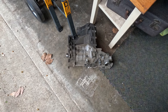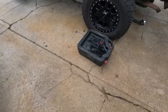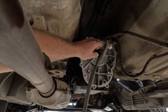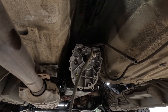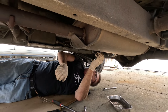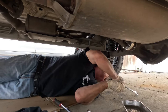As you can see, I got the old one out. It's a little dirtier but looks good on the outside — the inside's a bum. I took the drain plug off and found a couple pieces of spring or something. That's where it mounts right there — obviously the transmission is right here. Everything's installed now — just tightening off the rear driveshaft. I did put some oil in it. Going to drive it down the road to try it out.